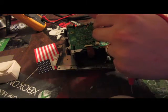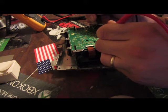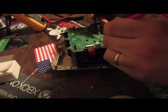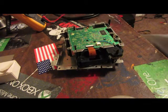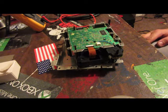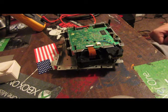Let's go ahead and just twist it a hair. We're at 340 — I want to go a little lower than that, around 200 or so. 400 is a little high. We're at 208 — I'll take it, perfect. So that's really all we had to do. All that screw removal is just to do 30 seconds of tweaking. You really don't want to do it without an ohmmeter or multimeter — you don't want to do it blind. Your laser is already not reading, but you have a much better chance of recovering it if you use a multimeter.